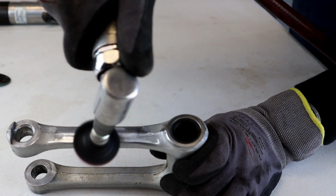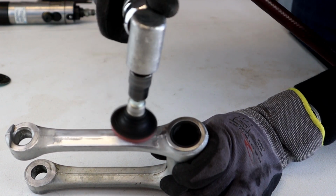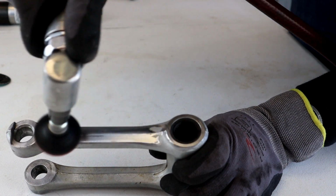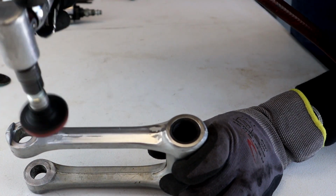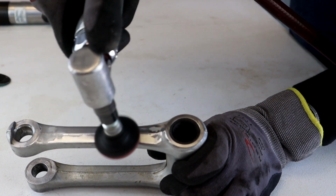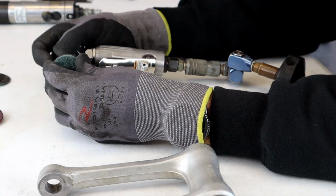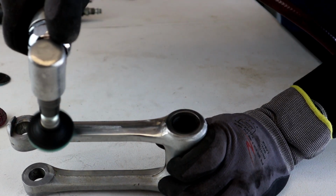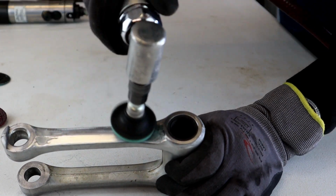You're going to want to keep the tool moving and not let it sit in one spot too long. You do not want to create any flat spots or any inconsistencies that would require you to run the part harder in order to make them go away. As you can see, the most abrasive pad cuts quite quickly. I'm already able to step down to the medium grit or even the most gentle of the pads. Experiment with different hand pressures, as you will notice that the material will cut faster or slower depending on this, and above all, take your time and just have fun doing this.